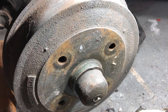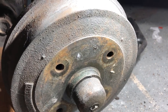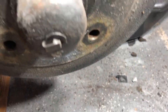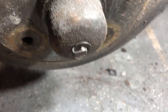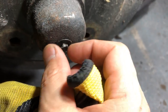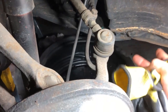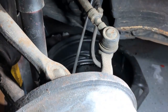I'll take this off. I don't know if I'm going to be able to get the rears off, but this is the driver's side front that I need to check. It has this little speedometer cable, so I have to remove this first — probably by pulling back, rotating, pulling it off — and then the cable should come out from the back.